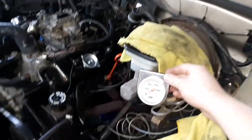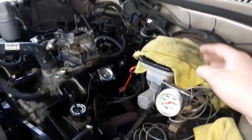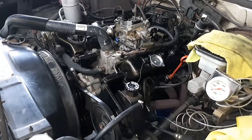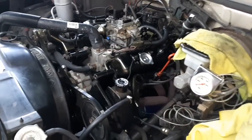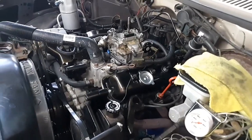So this truck has about 60 PSI cold, which is really good. And that's with just 10W30 and some zinc oil additive for the flat type of cam and lifters. They don't have zinc additives anymore in your oil. Especially after this is mixed like it has, you want to make sure that you've got the best protection you can for it so I don't screw up the bearings.